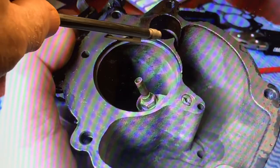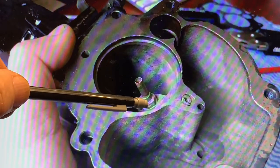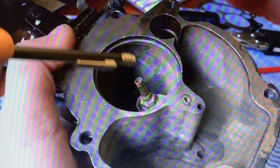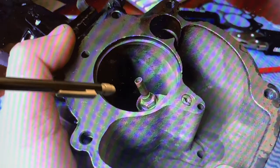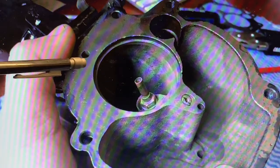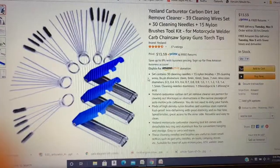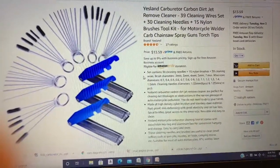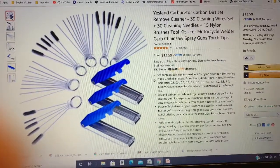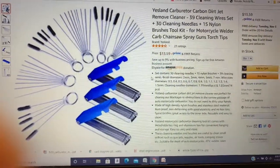The accelerator pump well and the bowl fills up with fuel. This is a really good shot of the main jet nozzle right here. The fuel comes upward, the air-fuel ratio comes together right here, the air comes in and it atomizes here. You can see there are vacuum ports and this is a fuel port — all of these have to be cleaned out and free of any debris. Here is something you'll need when you clean the carburetor — it's available on Amazon for about $13 and contains all the little needles you'd need to clean any port in almost any carburetor.